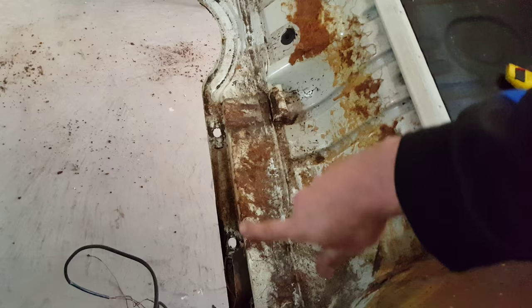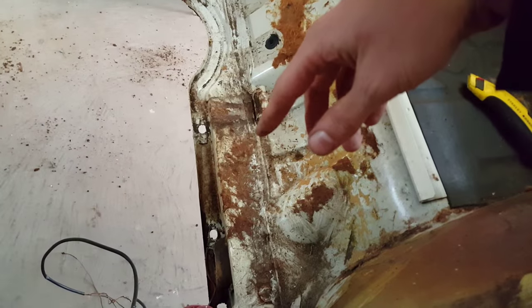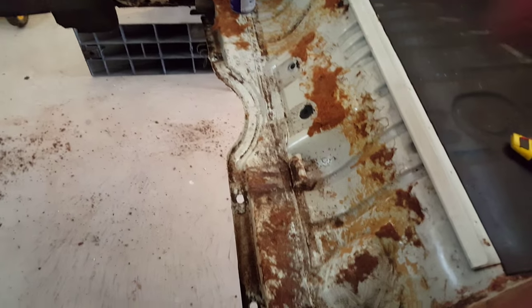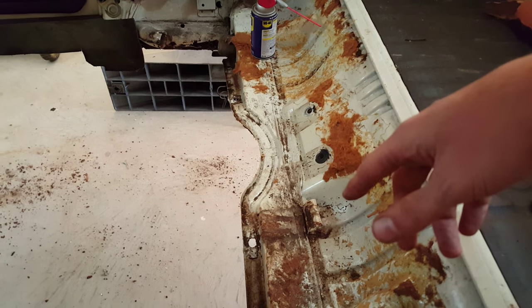You have to take the seats off. I'll walk through the seats for a half second once we get back there, just to tell you how to take them off. Big thing is going to be on the back. You gotta take these two bolts out, okay? Mine didn't have it. It looks like it had rusted through already. There was another bolt in the rear transmission, or to the side of the transmission going into the suspension, but I think it had rusted out or wasn't there anymore. But get these two and two on that side. I took the seat belts out thinking they might have been connected and they weren't, so no worry about that.